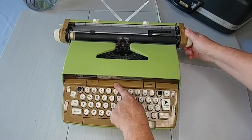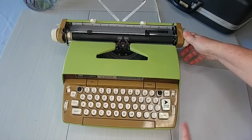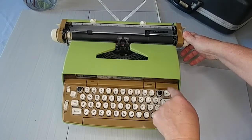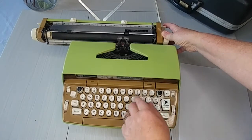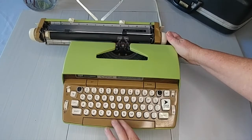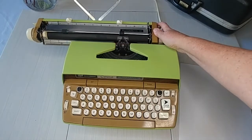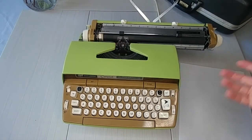Your tab is here — press down to set and clear it. Then there's margin release: when you get to your margin, the typewriter will stop, but you hit margin release and you can move and type beyond it. The power return is a little jolty, but you don't have to use the handle — just press the button.